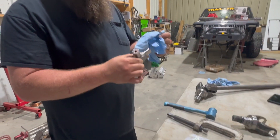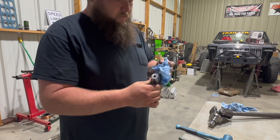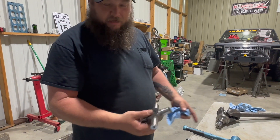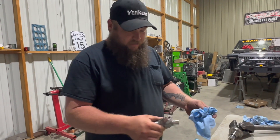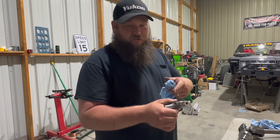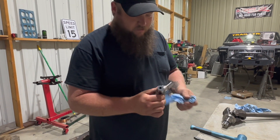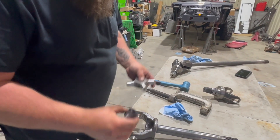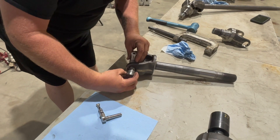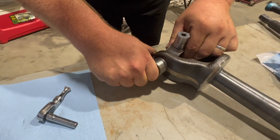When you don't know much about installing U-joints, just clean these up real good — the grease attracts a lot of dirt. I pulled a shard of metal off one when I cleaned it — I don't know where it came from, but that's exactly the reason things go wrong. If that got into the needle bearings it would've destroyed that cap on the first ride out. Keep these clean, keep them greased. Make sure your needle bearings are right when you set it in — stick it all the way out so you can confirm all your needles are in, then press it down into the hole.